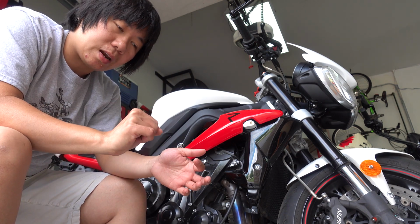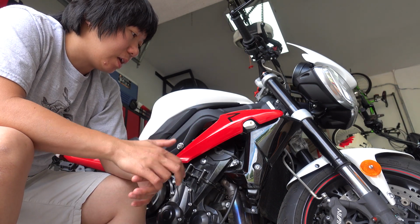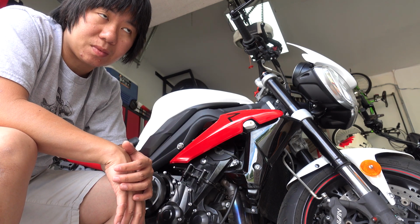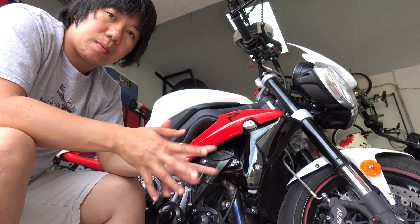However, it does require a lot of revving if you're going from a cruiser to a sport bike. So that's what I've learned about this particular bike, is learning how to keep the RPMs high, above 4,000 RPMs if I'm going to do a tight maneuver around a parking lot. But it's basically overall taught me to become a better rider.